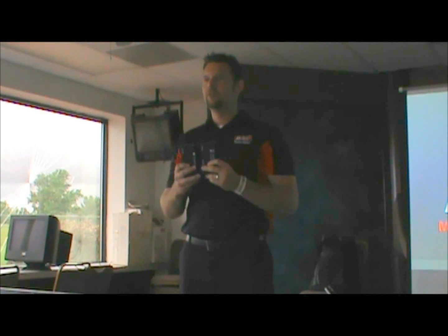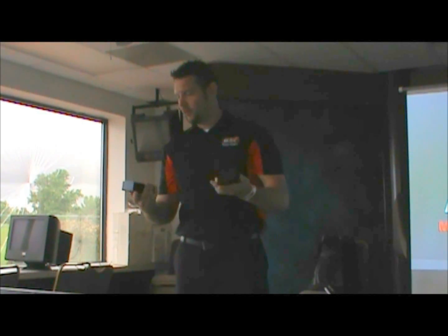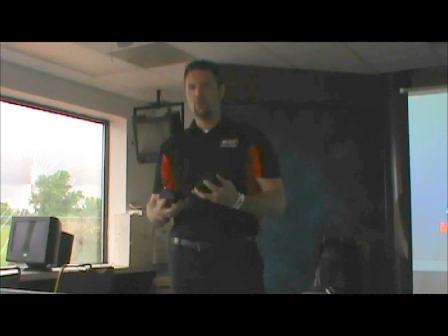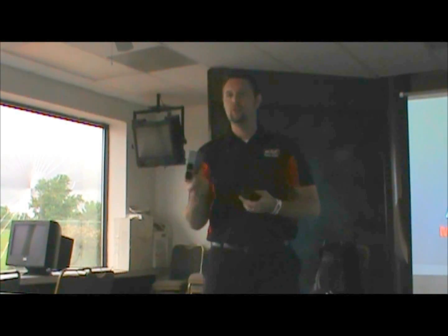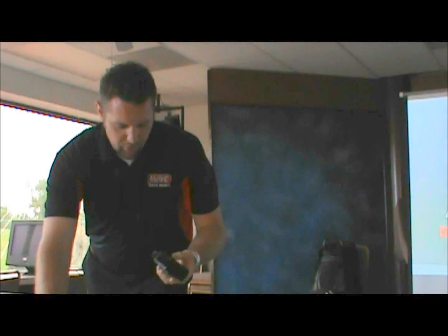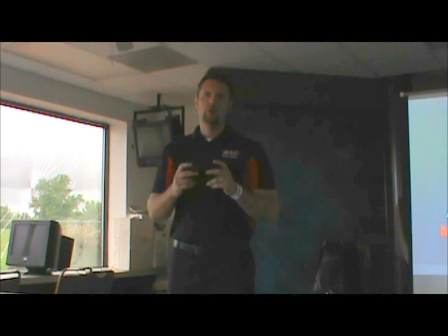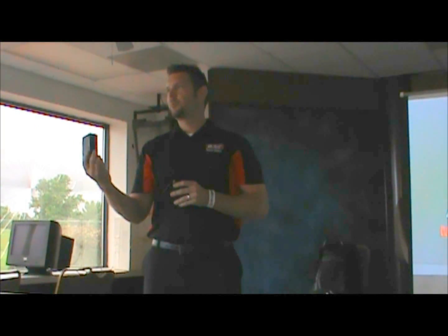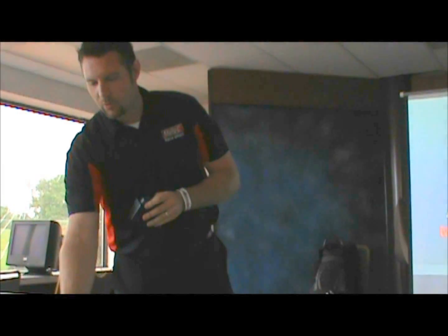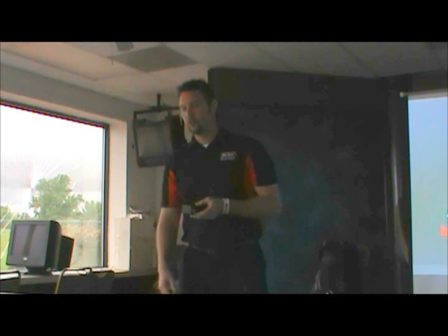The way we migrate this from different bike makes and models is by having a different adapter box. So whoever gets this kit needs to tell me what sort of bike they want to run it on, and then I'll give you the associated adapter box. What this adapter box allows us to do is to have this one, for example, as a mating connector to a stock harness for a Gen 1 1000. We cover Gen 1, Gen 2 1000s and Gen 1, Gen 2 Hayabusas. And this box can actually be used with a few wiring modifications to do some of the Kawasakis. We're working on one of them right now to find out the exact pin changes. It's a little bit more work, but it does work.